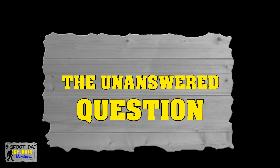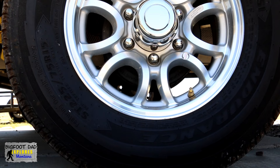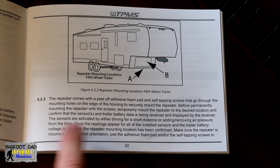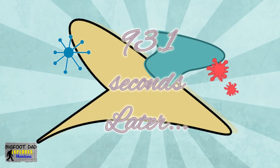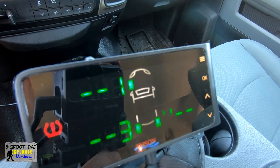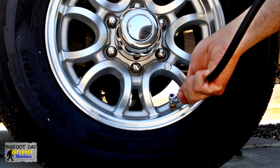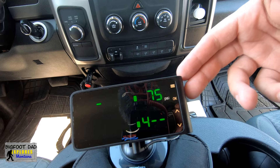One critical question still remains: what does this thing actually do with a leaking tire? Well, let's find out. According to the documentation, even if the wheel sensors are asleep, as the pressure begins to drop the sensor should wake up. Now we're getting a reading that we've got a problem. The display indicates in red that the tire has a sudden pressure drop, as well as a familiar TPMS warning icon. We can also hear an audible warning tone. Now we'll go ahead and fill the tire back up, and as expected, the display indicates the rise in pressure again.